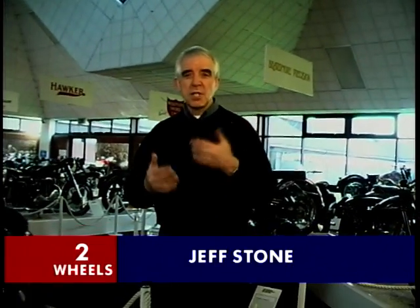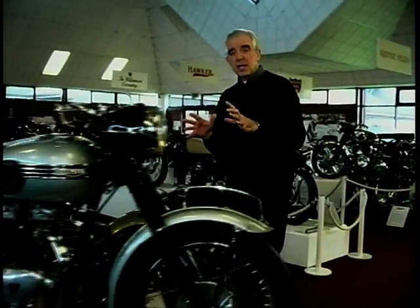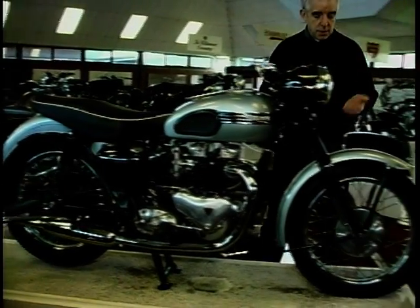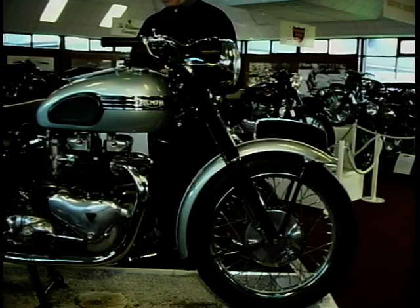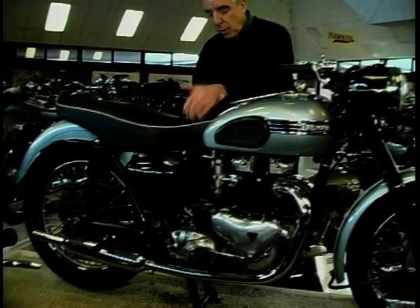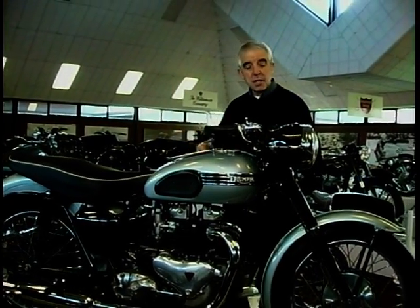Now, the history of the British motorcycle, we can't possibly cover it all in our programme, but what we can do is cover some highlights and significant machines. And in the last episode, if you were watching, I ended up with Triumph's Tiger 110, 1954. Terrific performer, good turn of speed, but the handling left something to be desired. Just look at these front forks, very, very spindly. And the frame, it used forged members down here and a rear subframe that was actually bolted on. And it made the whole thing pretty flexible. People used to say it had a hinge in the middle.